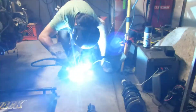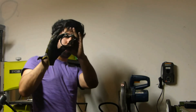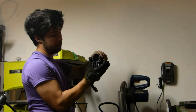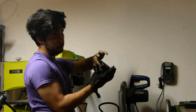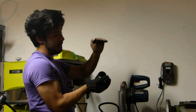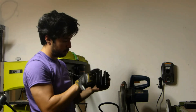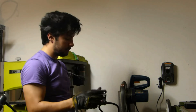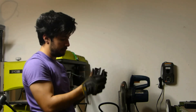After it was fully welded we made sure we didn't have too much distortion. We added in some bracing here, which basically extends your clamping ability further back in the tube that's squeezing the bottom of the strut. It also acts as reinforcing gussets. Without it, these mounts would flex at the weld joint corners and over time you'd have cracking, fatigue, and the piece would flex in and out as the strut compressed under torsional load — basically squeeze the hell out of the mount. We also reinforced this L-bracket angle iron: since it's 1/8 inch thick, we took some 1/8 inch flat stock the same width, welded it on top, fully around the outside, but not inside so we didn't interfere with the nut or bolt going through there.